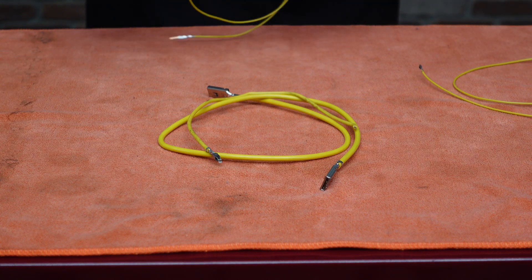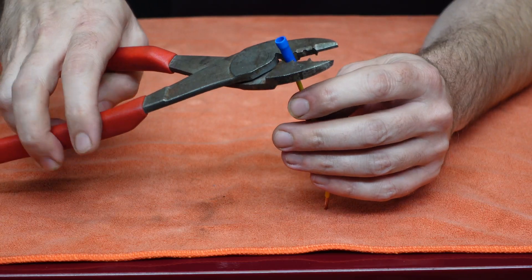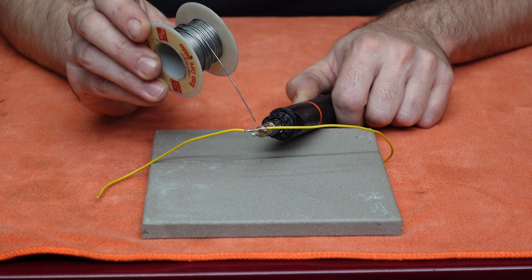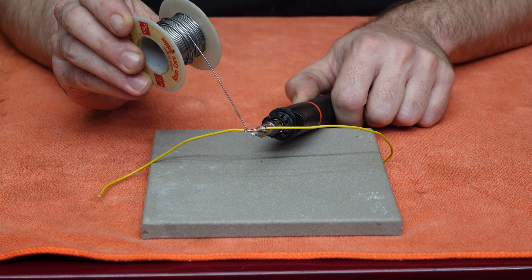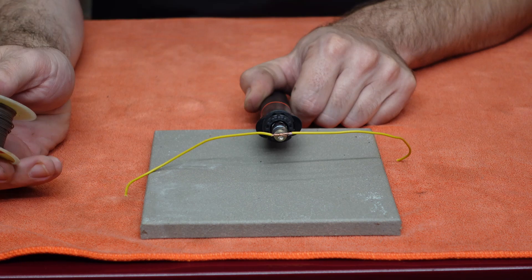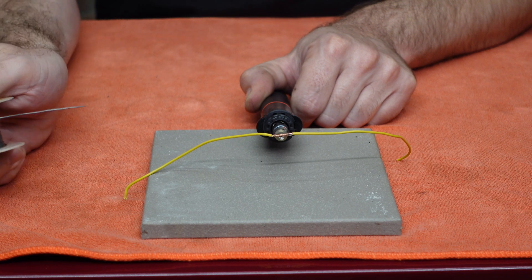When we think of a precision wiring repair in any setting, there are basically only two ways of doing it: crimping and soldering. Now to the layperson, soldering seems like it's superior because you are heating up the wire and adding a binding material to it in the form of lead solder. However, in an automotive setting, this method of repairing and joining wires is not recommended by any OEM for two main reasons. One, there are too many variables involved with getting a correct solder joint.